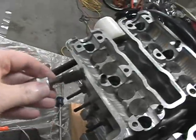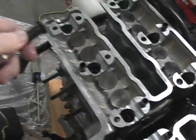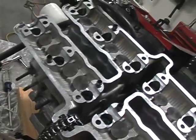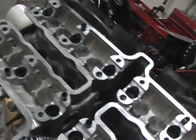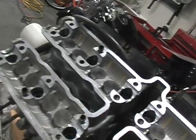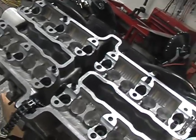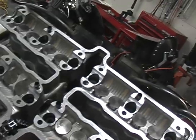The nuts are these long tapered ones with a 6mm on them, and they thread on the studs. Use engine oil on the studs. These get torqued to 25 foot-pounds in a proper sequence — look up the numbered sequence in the FSM. Make sure you do it the right way, and it also says do it in stages. Maybe do 15 first time around, then come back and do the 25.